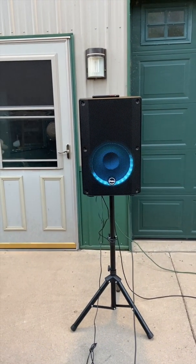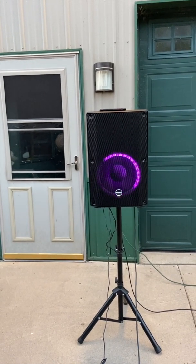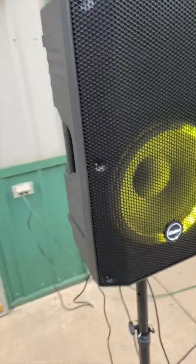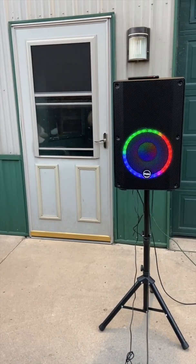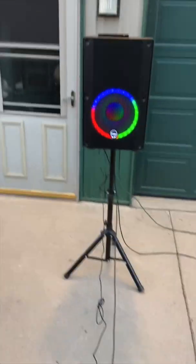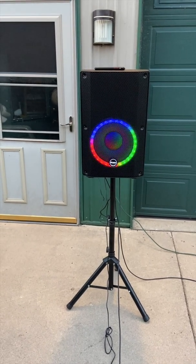The Hyonka mic is much louder — we've got a much hotter microphone. It's one where you've got directionality, so it's really almost too loud for this test with both microphones wide open. Let's adjust that microphone down, with the Shure wide open and the Hyonka set at three o'clock. We sound much better and we're not getting the feedback. As I talk and pivot the microphone, you can really hear this is a cardioid pattern — talking to the side of the microphone, you're not hearing it through the speaker. If I hold it down about eight inches away, we lose it, but within two inches of my mouth it gets pretty good pickup.